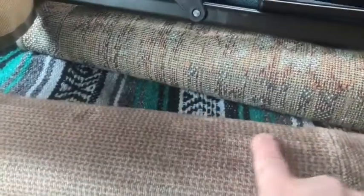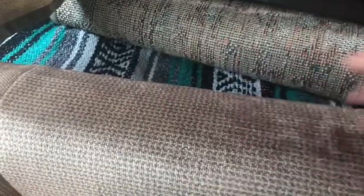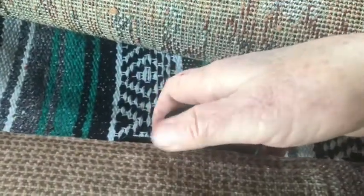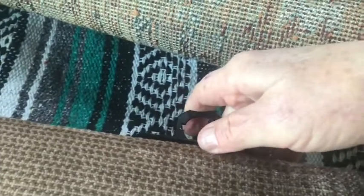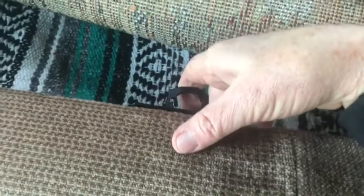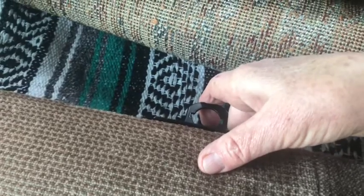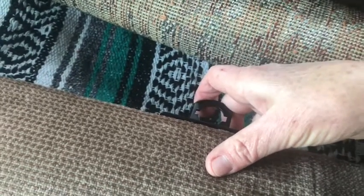So what I found out is that I have to get up here, and the headrest will insert into the upholstery, into the backboard. I considered putting the headrest bracket, being sloppy, on the back here, so I wouldn't have to undo the upholstery. But the problem with that is it looks really sloppy. It's too far back for the headrest to serve safely, and it also won't lay down flat when you fold the bed down. So that won't work for three good reasons.